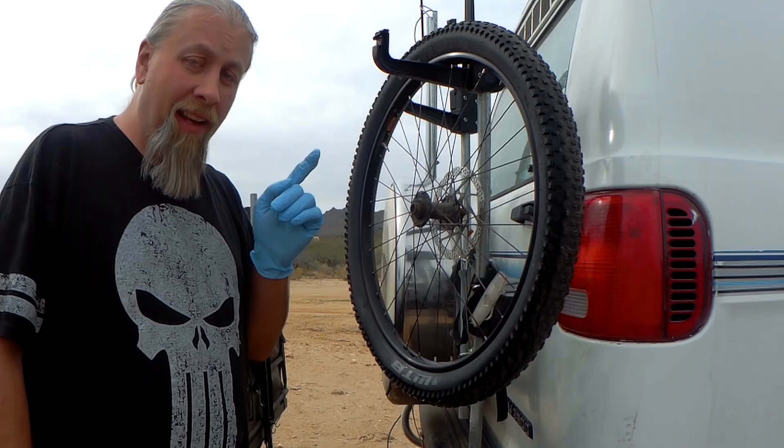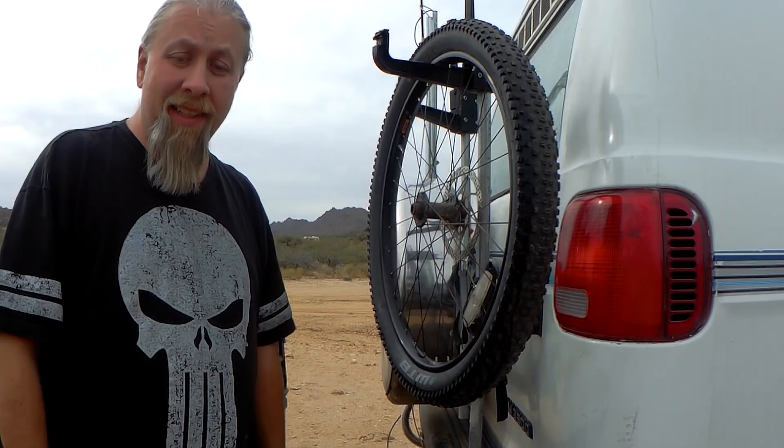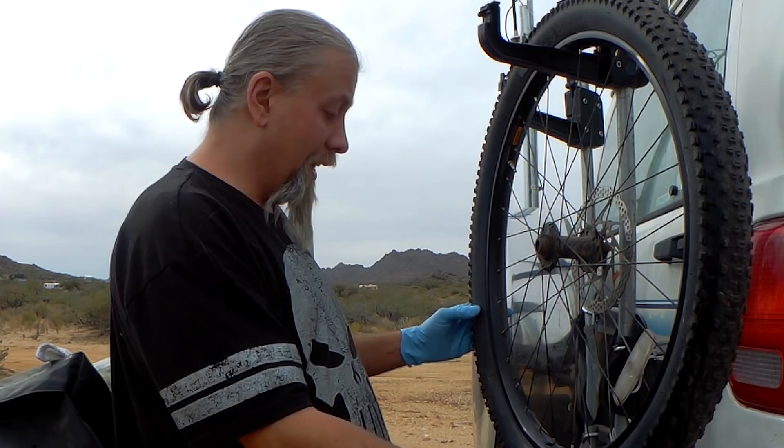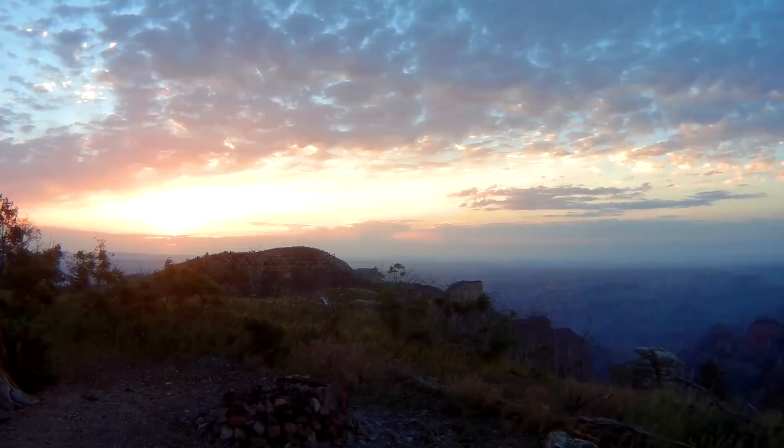Hello peoples. It's Friday and I'm finally going to get to the tires, although it's overcast. I've left my tires sitting out here for a couple of hours. The reality is that the tires are only 72 degrees — they're still going to be really hard to take off. You really should bake them to about a hundred before you take them off, but I can't wait another day. I've planned to go to the cemeteries tomorrow to do a video and I need the bike for that, so I'm going to make an attempt to take the tires off even though they feel pretty cold.